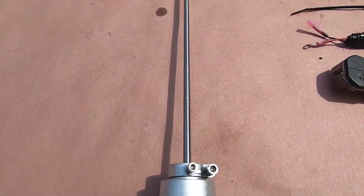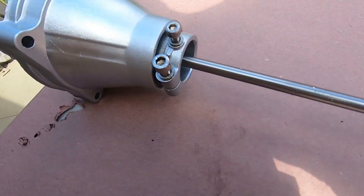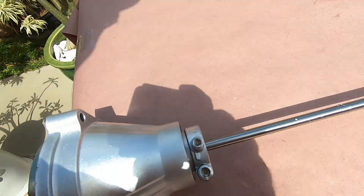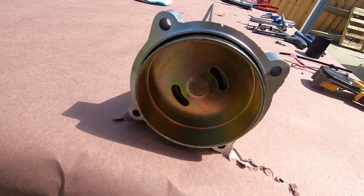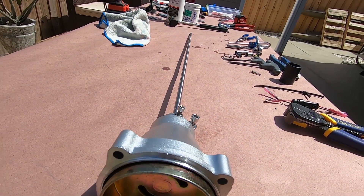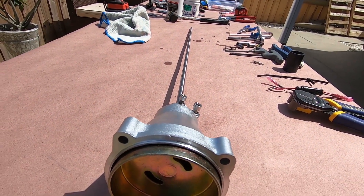I loop right underneath to manage the excess, and also so that if you bring the tiller arm down for storage it doesn't get in the way. Here's a close-up of the drive system: a hardened shaft, nine-spline end. Inside the clutch housing there's a bearing — I usually throw some grease in there, especially on the upgrades. Pull it out and grease it at least once a year.